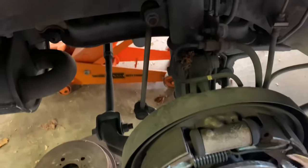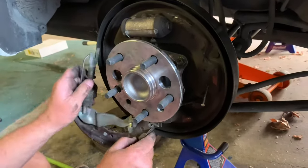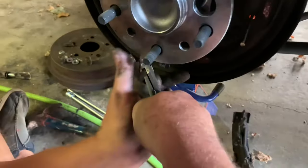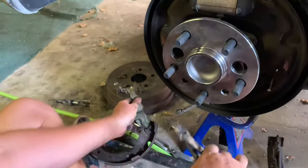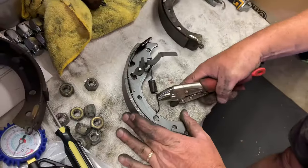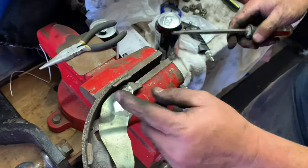There's no real easy way to do it, but I'm going to try it with the vice grips here. There we go. Now pull that off — parking brake cable — you kind of push out and rotate, and then it comes right out, like a bicycle cable.